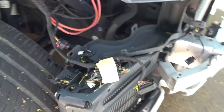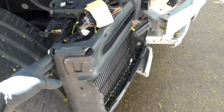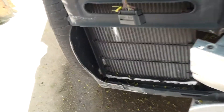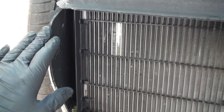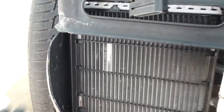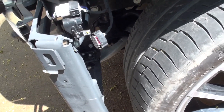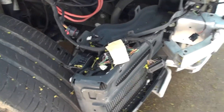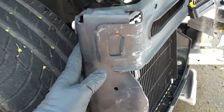This piece is right in contact with the wheel, so it's definitely pushed in too much. You can see where a lot of the hit and energy dissipated — the impact went into this piece and it's all distorted. Comparing to the good side, it's nice and straight with plenty of space between the wheel. But on the other side all these pieces are distorted and got really pushed in — it's in contact with the wheel. So this big piece will get replaced.